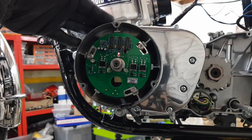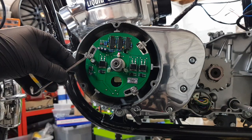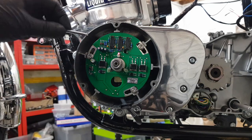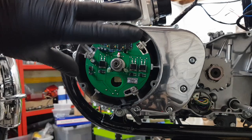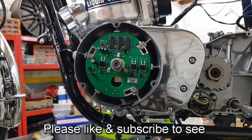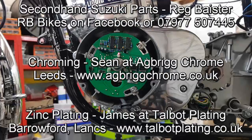I've set it this way and checked it with a strobe — they're always bang on. That is the easiest way to do it: no points, condensers, setting everything. That's it, you're done — dead, dead simple. They are idiot proof. On here you can see this slot is right up to the extent of me extending the hole, so it really does pay to elongate these holes so you can get maximum clockwise movement when you time it up. That is now set. Enjoy — please like and subscribe, and it will keep me doing more of these videos. Thanks for watching.